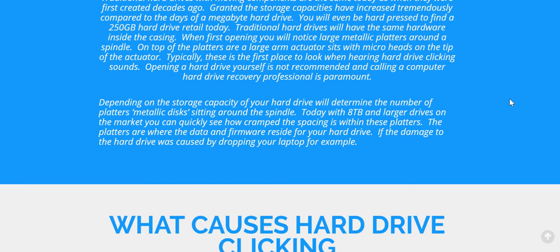When you first open up a hard drive that's clicking, you want to do it in a dust-free environment. Usually you'll have a clean room or a clean room hood that prevents dust or particles from getting onto the surfaces inside the drive once you take off the cover.